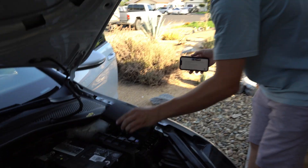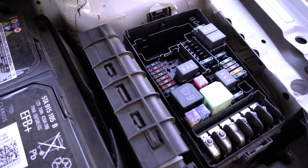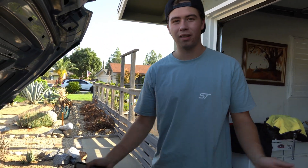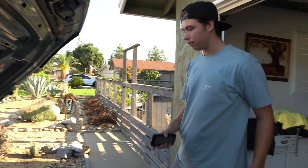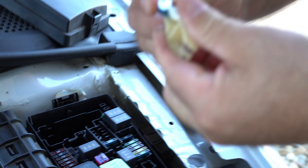The first thing we're going to do - we looked up the fuse box diagram for the Golf MK7 and number 10 is a 15 amp fuse. Come over here, it's going to be this top fuse right here. Pull that out and run the car until it shuts off so all that high pressure gets out of your fuel pump, so when you take the lines off it doesn't spray in your face.